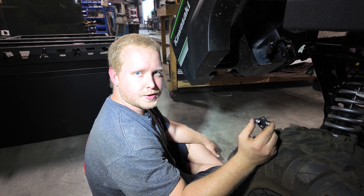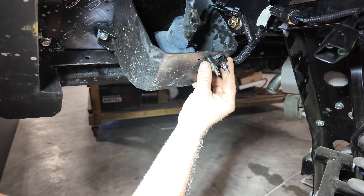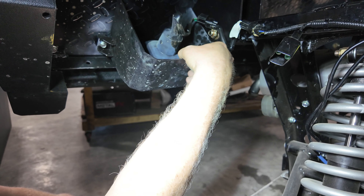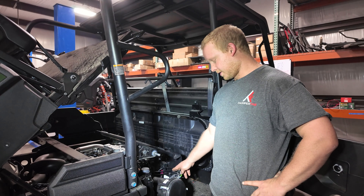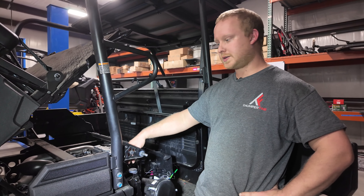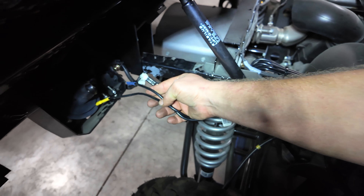Here we have the junction box we're going to use to extend the wires from the winch contactor box up to the winch on top of the bed. We'll use it as a template by placing it on the underside of the passenger side brake light mount, marking with a pen or pencil, drilling the holes out, and then mounting it on the inside of the tail light assembly to keep it clean and out of the way. Once we have our junction box mounted, I went ahead and connected the wires from the winch contactor box to the battery and ran the wires from the contactor box back towards our junction box, zip-tying excess wire out of the way so it can't contact any rotating or hot components.